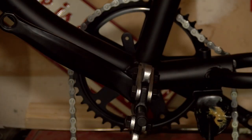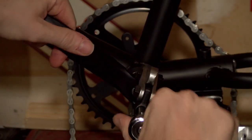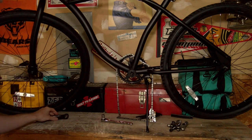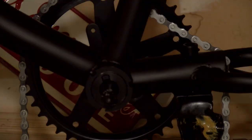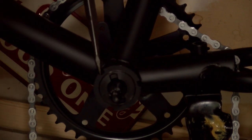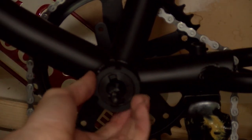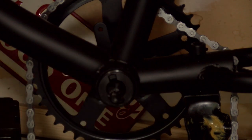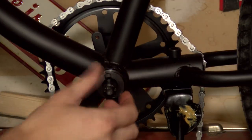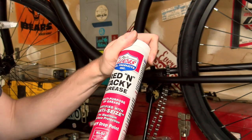I'm just going to tighten it until it pops off. Then you just want to use a flathead screwdriver and hit on it with a hammer like I'm doing here until it comes loose. Same with the inside ring — do the same thing, just use a flathead and beat on it until it comes loose.